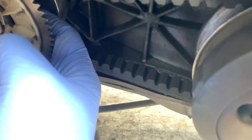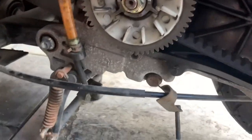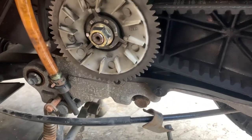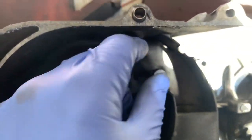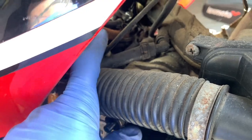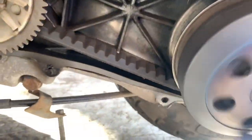Sometimes you also have a little washer in there, but that isn't usually on Euro 4s unless they're restricted to 25 kilometres an hour, which isn't the case in England. You just pop this off and take that washer off. Now if it did have a speed governor on it, you just unplug it, because the ECU needs a speed reading — sometimes it takes it from the speedo directly, sometimes from the back wheel. But someone's already done away with it — I can see there is a plug which it plugged into, so this has already been de-restricted for full speed, but it'll just take ages to get there. That's the pickup for the speed.